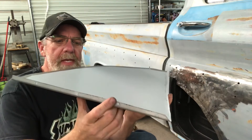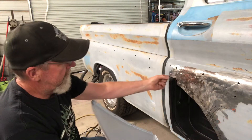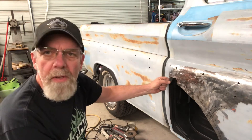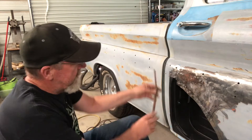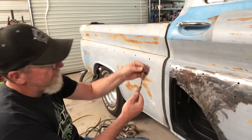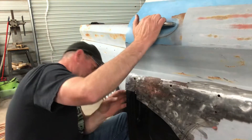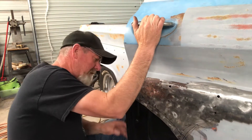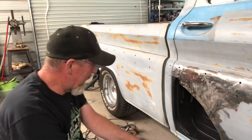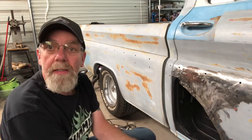I sprayed the back of the panel and talked to my sheet metal guy. He said to leave the paint back about a half inch so when I weld it I'm not burning paint — then I can reach in and spray it afterward if needed. I also drilled some little holes on the end here so when I bend it around the inner part of the door I can put little spot welds in to hold it all together. I ground down the inner piece spot welds, cleaned it up, and painted inside there just enough to take care of the rust. I think I'm ready to tack this on and start.